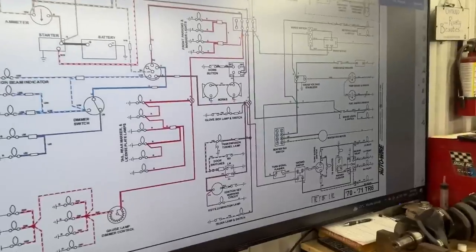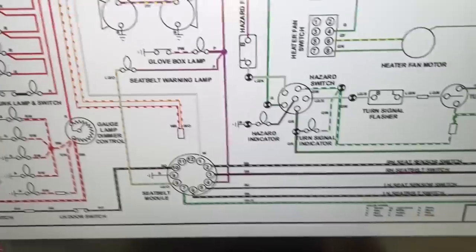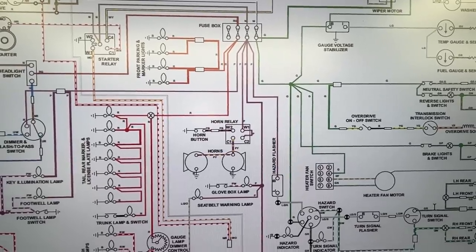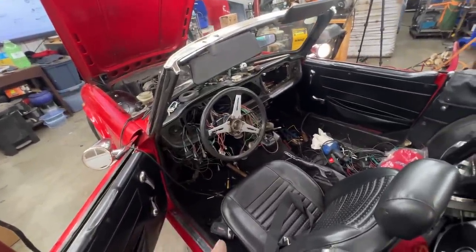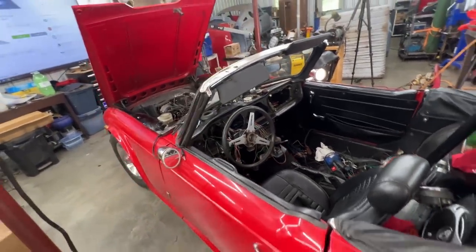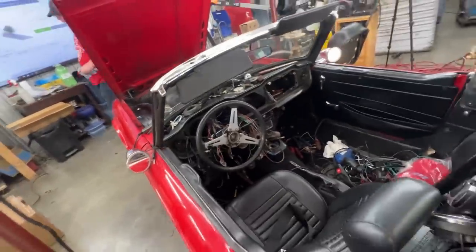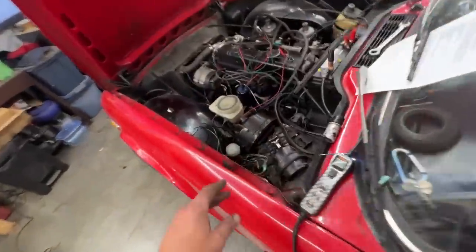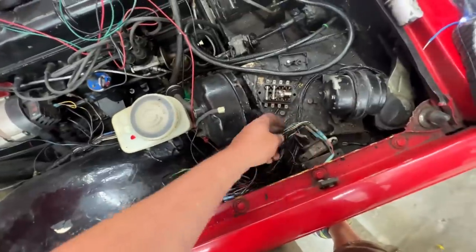This is the case for all years — let me check for '75 and it's still the same. I hope that's helpful, Steve. I think now we've confirmed that everything is working. We haven't tried the ignition switch yet but I'm sure it works because I connected it. We're at the point where I can start cleaning the wires — it's a mess, everything is working but it looks like spaghetti. So now I can start wrapping the harness and grouping the wires — for example, these can be one branch, these ones another branch.